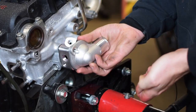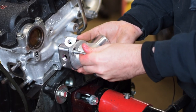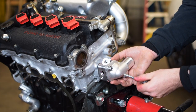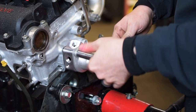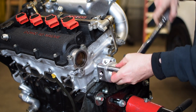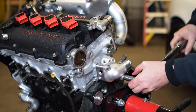We're going to take the shorter of the two provided bolts and thread it in the top position, and the lower position gets the longer bolt. These are just 12 mils, so we'll snug those up — the torque spec for these is 16 foot-pounds. Next step, if you're doing this off the car, you want to install the coolant temp sensor beforehand; the instructions call that out really clearly.